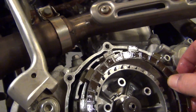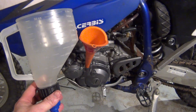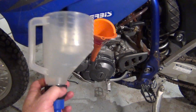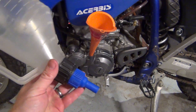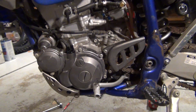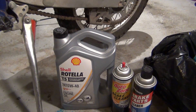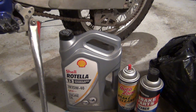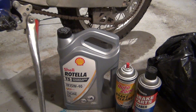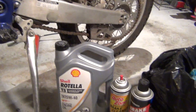It all looks good, so we'll just put this back together. Got the clutch back together and it's time for the oil. It says it takes 1.3 liters, so this goes up to a thousand - I bought this at Walmart a long time ago; if I can find one online I'll put a link in the description. All done with the oil. Still have a drip here and there just from the messy skid plate. Put in some 15W-40 T5 - it's going to be warm soon so it's good to run some heavier oil, especially if you're giving this bike a workout on harder trails. Even the manual says to run a heavier oil.